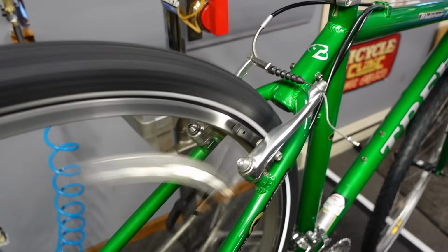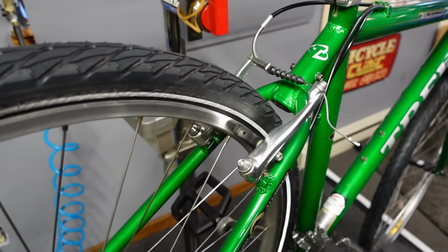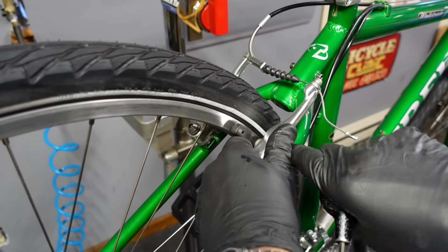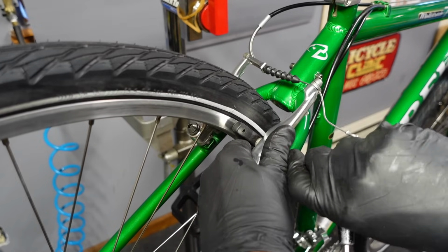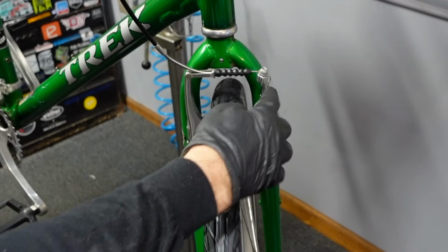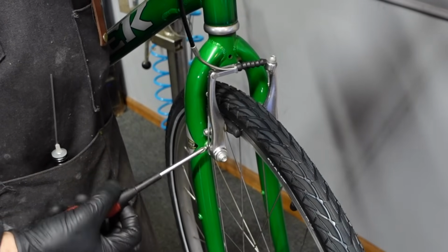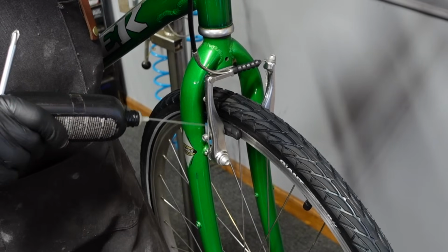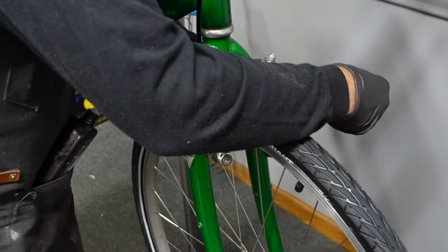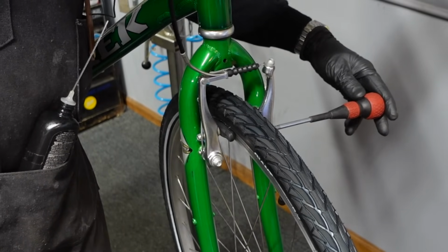Yeah, I mean, pretty good. I'm feeling underneath for those pads. This pad can come up a smidge. It's just riding a little bit lower than I want. And over here on the front brake, we can see things are pulling a little bit more from the left side there. I'm gonna add a little tension. Doesn't seem to be moving. Add a little bit of lube. I'm gonna release some tension from the left side. That seems to do the trick.